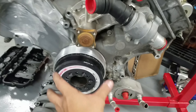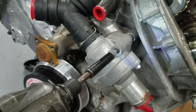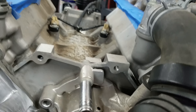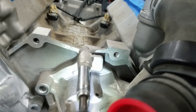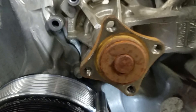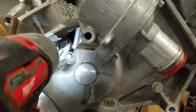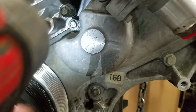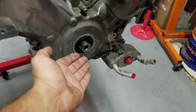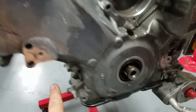It's time to take the front timing cover off. Let's go ahead and do that. Water pump. Had to get these guys loose by hand first because they were on there, no bullshit. All right, let's keep on trucking. After taking the crank pulley off, I'm gonna take all these bolts out to get the timing cover off.